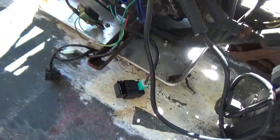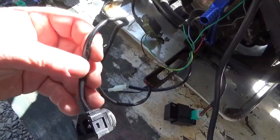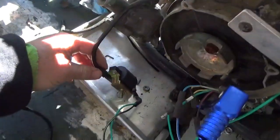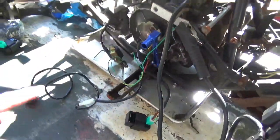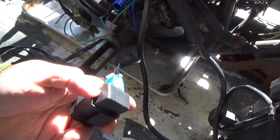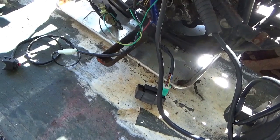When I get these things, occasionally I have problems such as: you could get a bad switch — I haven't seen that yet on all the ones I've bought. Occasionally you get a bad coil — I haven't seen a bad ignition coil that wasn't mechanically wounded. But I have seen a few bad CDIs, particularly the 12-volt ones. They like to go bad.